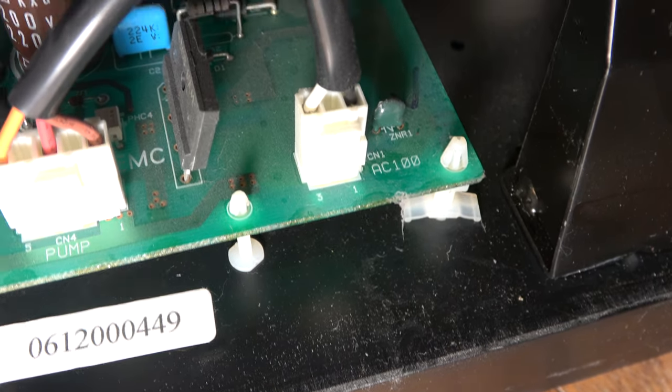Let's unplug the remote here and whatever sub is and see if that overload goes away. Nope. So that's eliminated a lot. So it's likely on the main board here. What else can we unplug? About more or less everything. So whatever that connector is, I've unplugged. And the one next to it, there's an enormous ribbon cable here. I'll come to that one later. I've unplugged these two. Let's see if our overload has gone away.